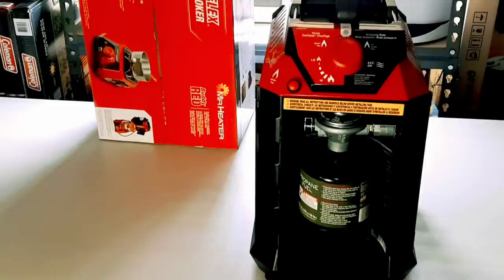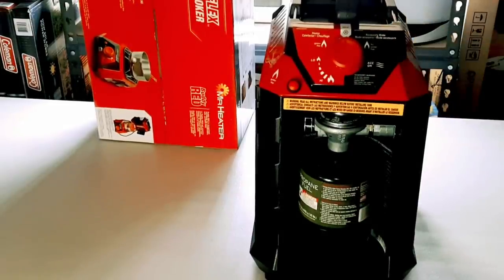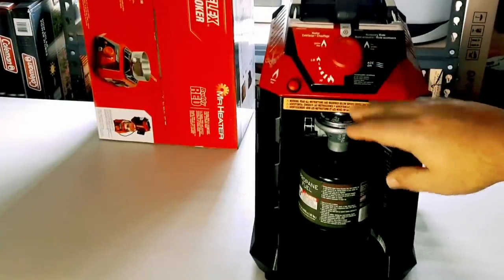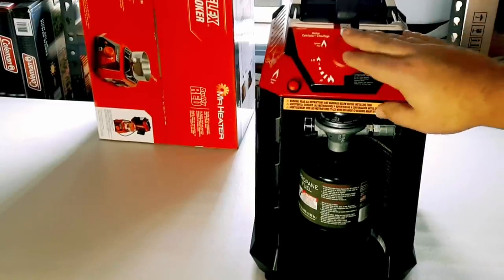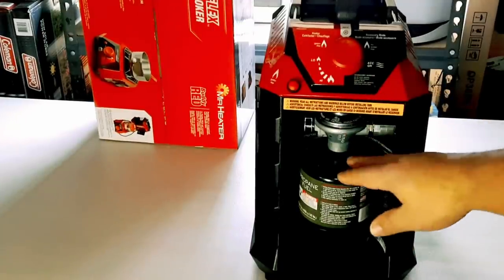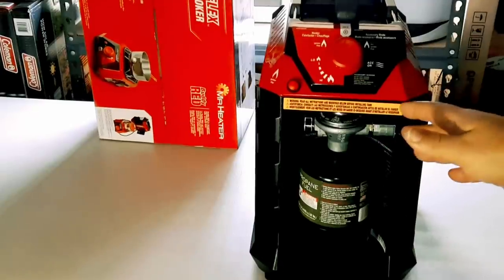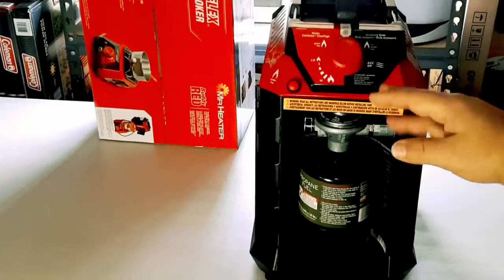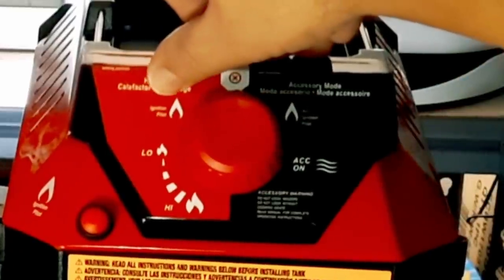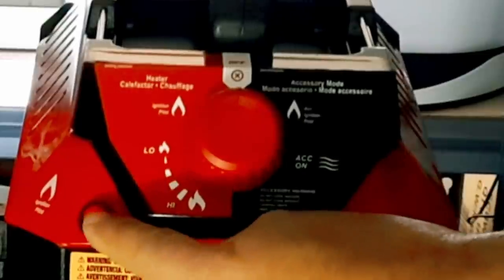I found something I don't like — I put my propane canister on and realized that the front of the unit is on the opposite side from the starting instrumentation, which makes it difficult because when you want to see the pilot light you have to either get to know this area pretty well by feel. I did purge the line to make sure there's propane in it — I was able to smell it on the other side, so the line is purged of air and full of propane. To turn this on, you take the knob to where it says ignition pilot, press down on the knob, and press down on the ignite button as well.